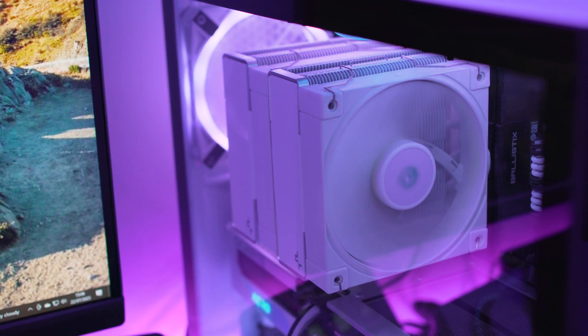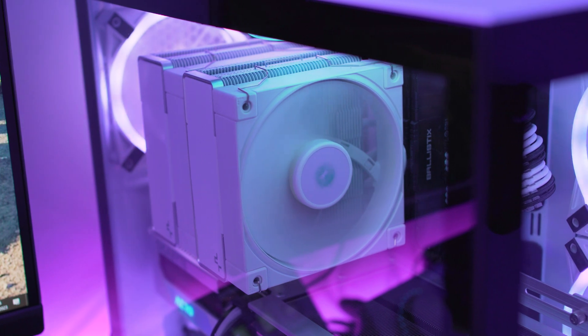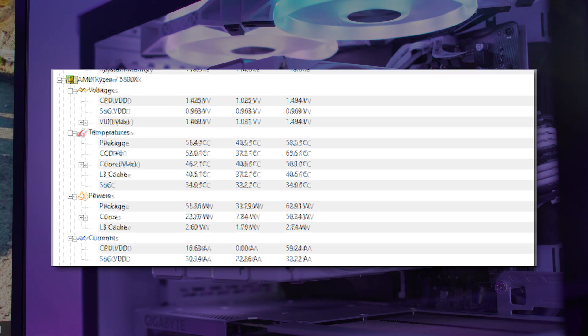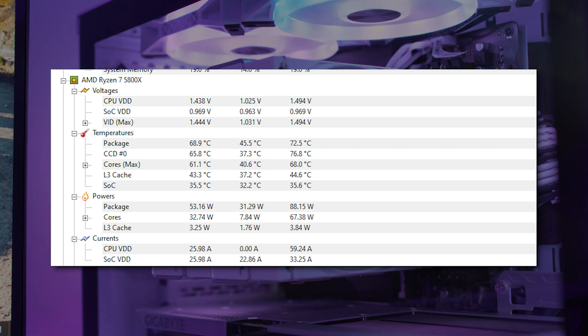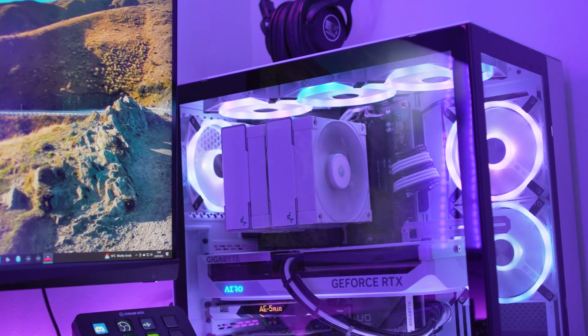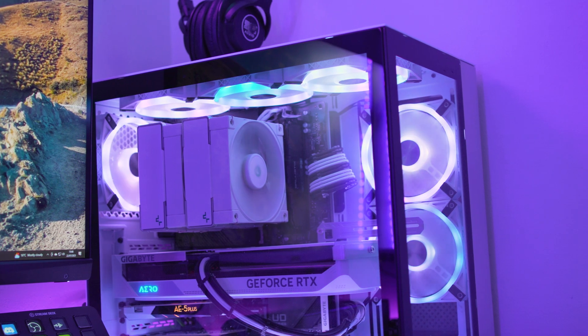Being a CPU cooler, nothing is worth it until you know how cool it can keep your CPU. Even without any serious overclocking beyond motherboard performance modes, the cooling capabilities of the AK620 are great. At idle it managed an average of 51.4°C with a low of 45.5°C. A Cinebench single-core test gave an average of 68.9°C with a high of 72.5°C. The multi-core test ran an average of 90°C with a high of 90.3°C — it wasn't throttling for a sustained period, and performance during gaming was also impressive.